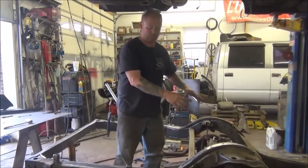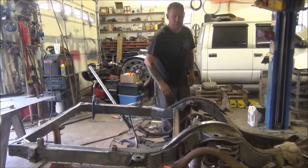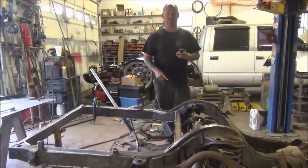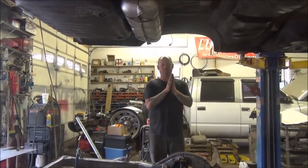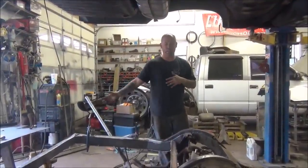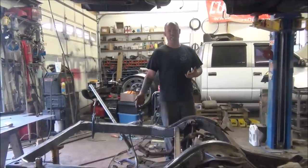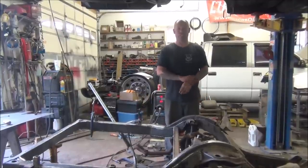Reinforcing the rear arches as well as boxing all the way to the front like what we're doing, and putting in this reinforcement bar, is one way to help prevent the frame from actually twisting. Because when you start twisting frames, first off, you're never going to get the frame back to the way it was. You can get it close, but it's never going to be the same. Second, once you start doing that, the body, the doors — where the doors close and meet the body — they're going to have gaps that are really hard to fix. I could have simply put the hydraulics on and been hopping this weekend, but I knew long-term that had I done that without the discipline to avoid three-wheels, I'd have a '64 Impala convertible with big gaps in the doors and a twisted frame that's not worth a crap.